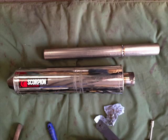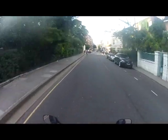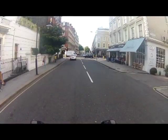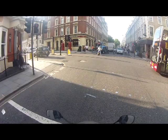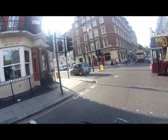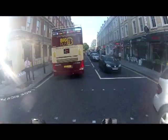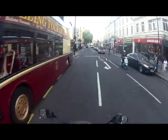I've sleeved the Scorpion exhaust internally about two-thirds of the way up the silencer, so effectively only a third of the silencer is doing anything now. It sounds okay — it's louder, beefier, and has a really nice tone above about 7,000 RPM, but it is a bit raspy when cold. I think it would sound better with a shorter exhaust, but not as short as the stubby one. Oh, nice little Morgan!